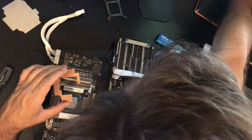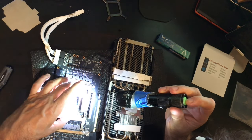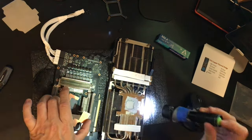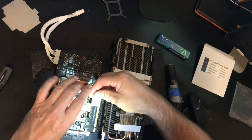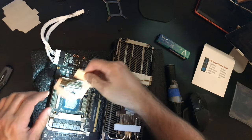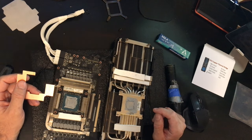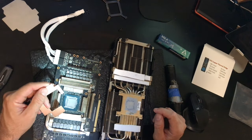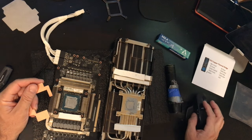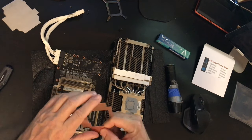Let's just let this rip. You're going to see me fumble around like the idiot I am, trying to figure stuff out in my little monkey brain, and I eventually get it, and I'm going to clean stuff off. I try to scrape the paste off first, and then I wipe it off with a lint-free rag using isopropyl alcohol, 97% alcohol, I don't know what it is. I'm just trying to figure out how this thing goes because I'm a total idiot. I've got to remove that last heat sink sitting right around the processor unit. But this is for your entertainment pleasure, knowing that there's an idiot out there that can do this, and that means you guys can do it a lot easier. The next time I do this on my 3080 Tis, if I do it, it's going to take me like 10 minutes.